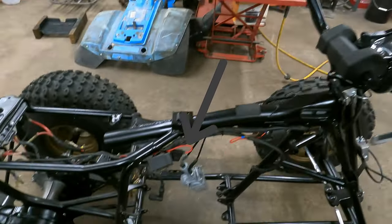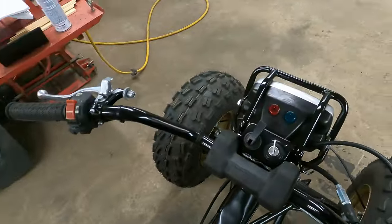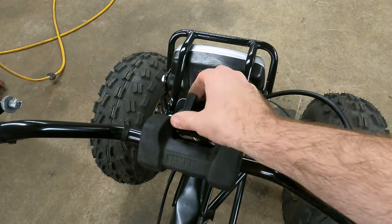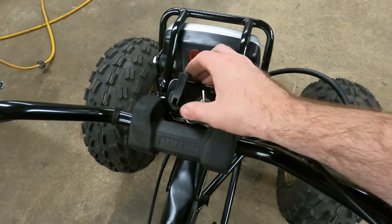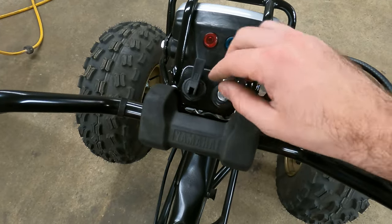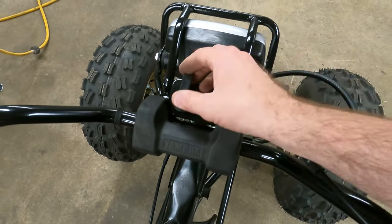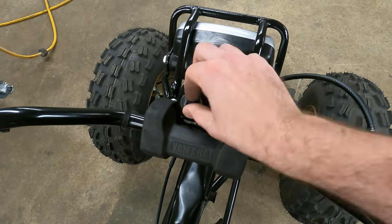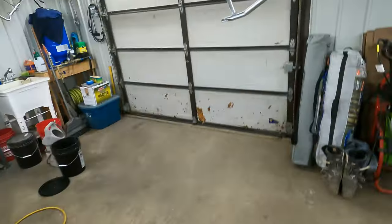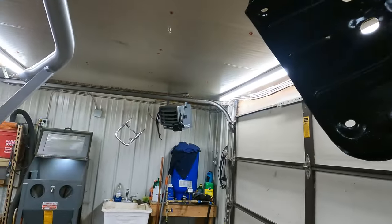So I got the carburetor in there and it's just kind of chilling down there. Got the throttle cable on, got the choke on, so the dash is done — it looks pretty good. I ended up bead blasting this choke lever with the same glass bead that we did the carburetor with. It actually works super good because there was some blue spray paint on it — it took all that off, but it also took the white out of this choke sign right here. I might try to get a white Sharpie or some white nail polish to fill that back in. Other than that, all of this stuff here is dry and ready to get put on the wheeler.